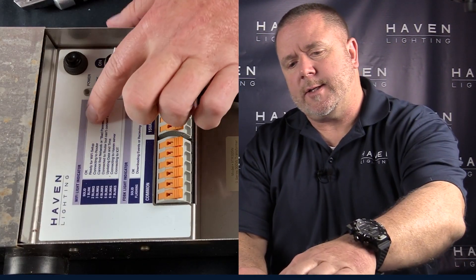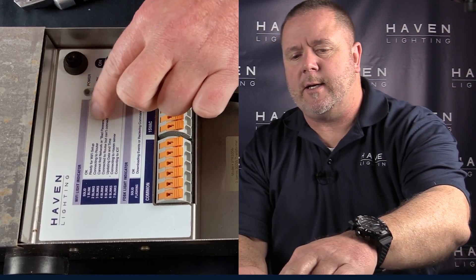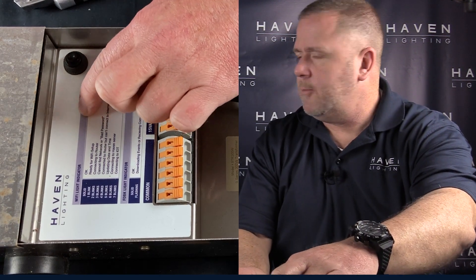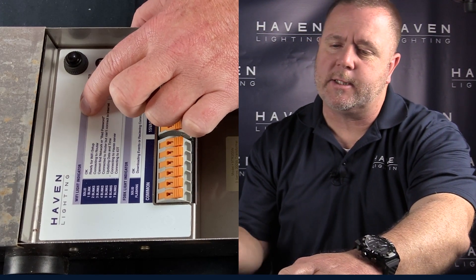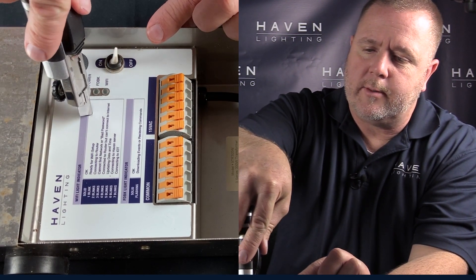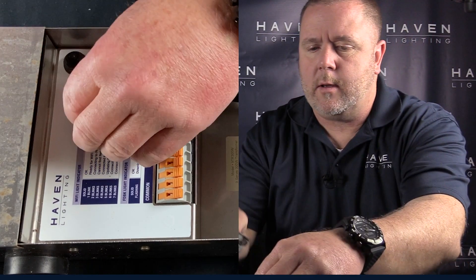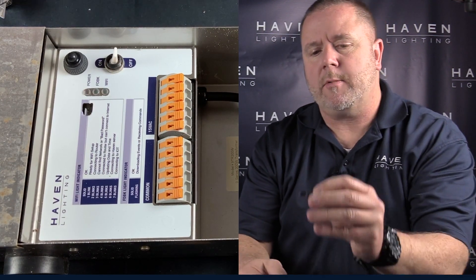On this sticker, you'll feel right in this area next to the LED lights that there are two places that do not have backing or metal behind them. We're looking for that top section. I'm going to take a razor blade, cut the sticker right along the edge of that hole, and peel the sticker out — which exposes our logging port.